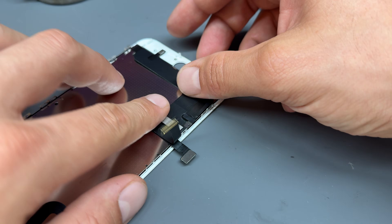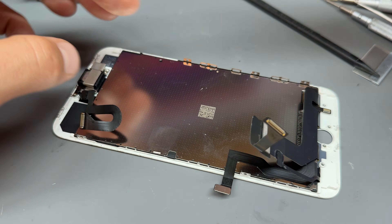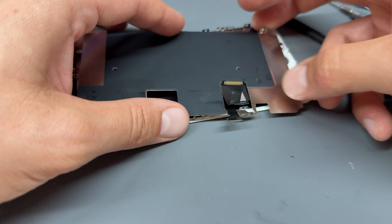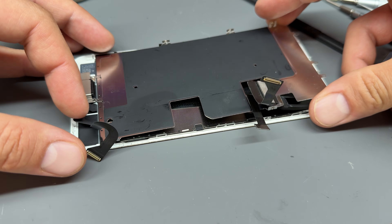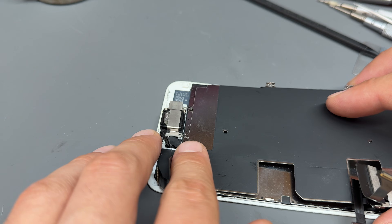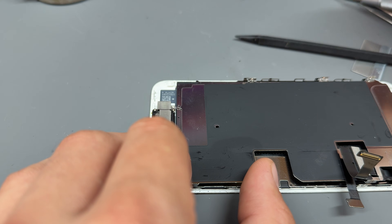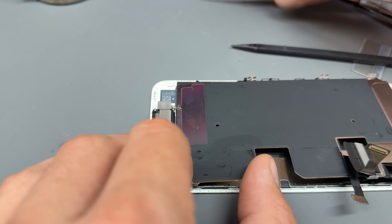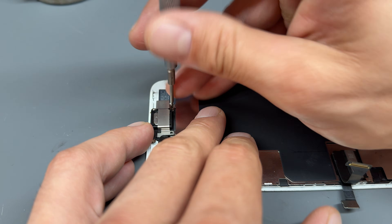So you can see how it's stuck — that's where it's going to sit. Then we're going to reattach that metal aluminum shield. Thread that cable through there, thread the other cable through there, make sure it all sits nicely, no cables are getting snagged, and run it underneath these parts — just putting everything back how we found it. I made it awkward for myself by not unscrewing three screws, so I'll just loosen that one off so it slots under there.